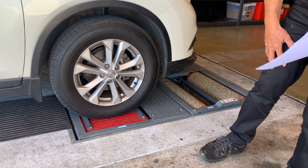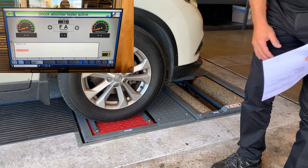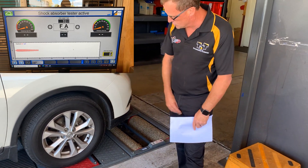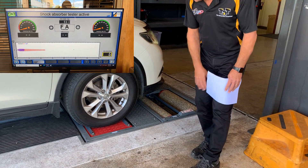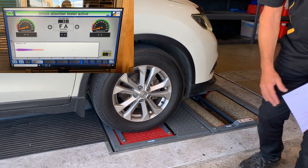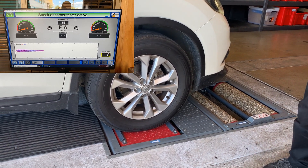The second tester here — first up it'll look at the weight of the vehicle, so it's comparing right and left hand weight, but also it's doing the suspension tester. We'll start to now test the shock absorbers on the car and collect details. You can see it's starting to shake there now. It's testing the shock absorbers and that will increase the duration and severity of the test, and that'll pick up on the report we'll get up shortly.